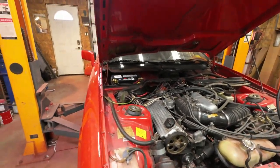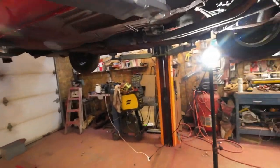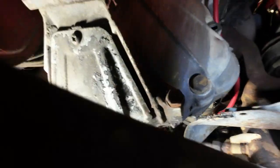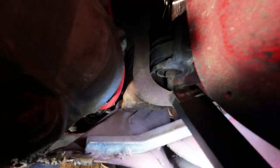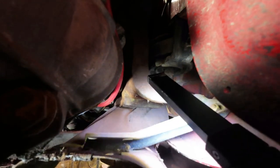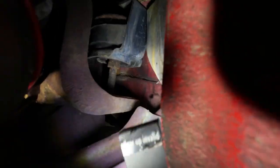The reason I'm thinking about motor mounts is because there's no room in between there. I've watched other videos online and it seems people can reach their spark plugs and I can't. I'm going to see if the motor mounts are worn right down — that might help because it doesn't look quite right. No wonder the motor's hanging so far over on this side — the motor mount's not even hooked onto anything.